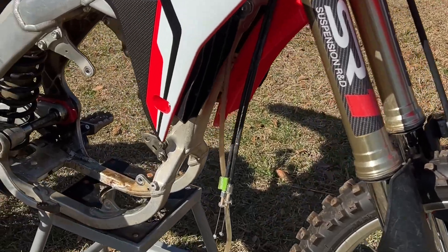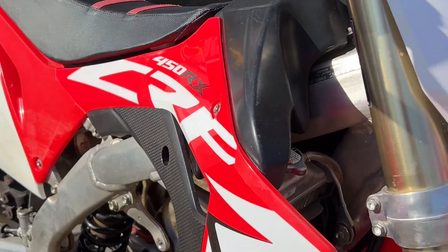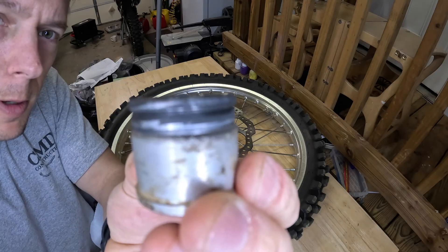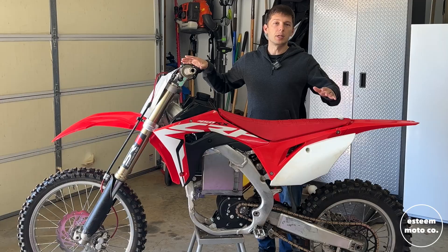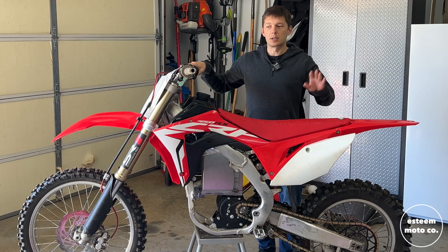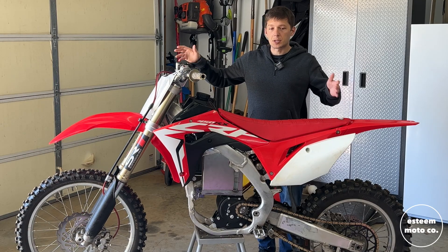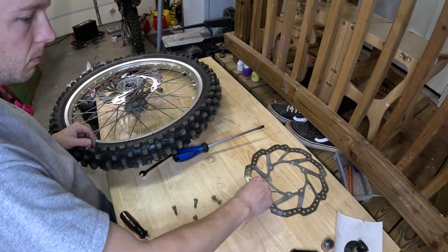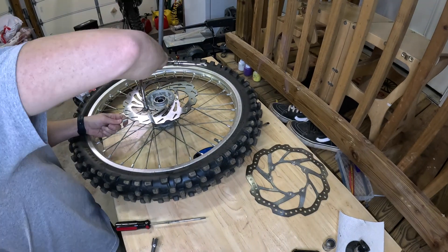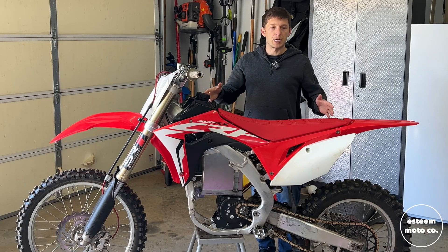Number one, I would probably find a better frame. I'm not saying the Honda CRF frame is a bad frame; I'm just saying the one I bought looked really good when I picked it up. But once I got it home and started taking it apart, basically every bearing was shot, every seal was shot. Sitting on it in the parking lot felt fine, but once I started riding it, the rear shock was gone, the forks probably just need rebuilt. The brake rotors were warped, and the rear brake shoe was actually outside the caliper, just dangling. Once I fixed those things, the frame was actually in pretty good shape.